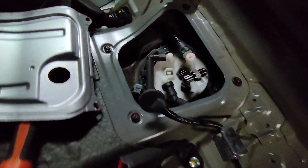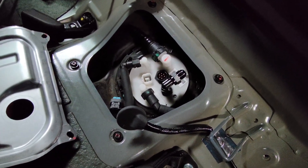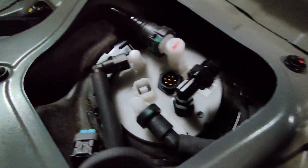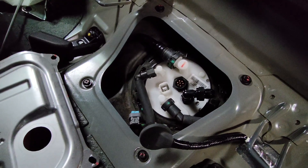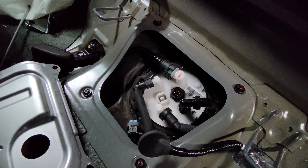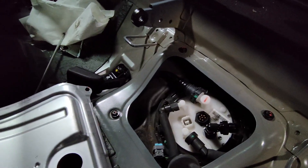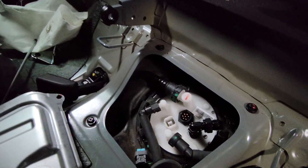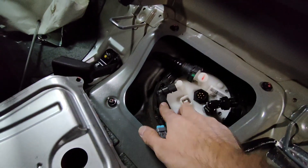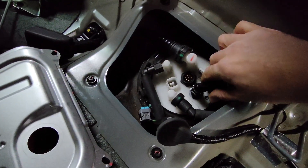Back here, something special — I just put the 525 in the basket with a few zip ties. It's really pretty simple actually, but I've got some fittings back here to make this work. I've got a seven-pin connector here; they're rated for about 20 amps per pin. I'm using two pins to feed the power and two pins for the ground, just to be safe. I've got some 10-gauge wire over here. I'm going to wire everything tomorrow, but everything is stock. This is the feed line — it's actually a 3/8 coming out of here and it's 5/16 up front, which is weird.